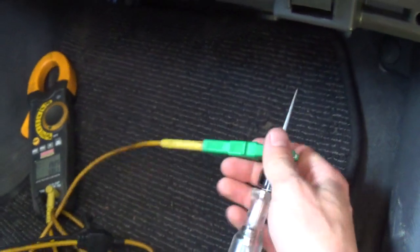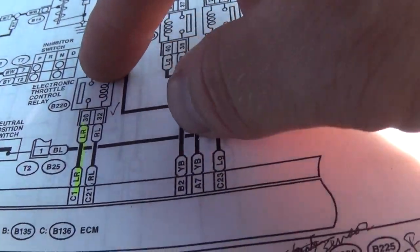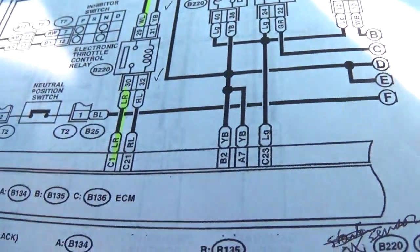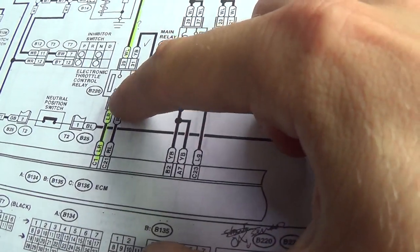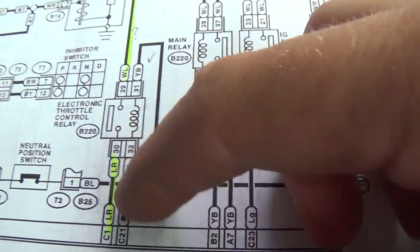Basically, this is actually like a load pro — you're connecting the voltmeter from here, and that's piggybacked to the ground. So it looks like the problem is not from here to here. Now let's dig the PCM out again and check this little leg from pin 30 to C1. Here's the next test: we want to check continuity of this wire right here from pin 30 to C1.